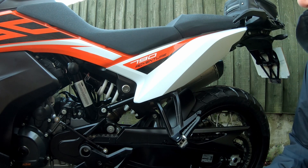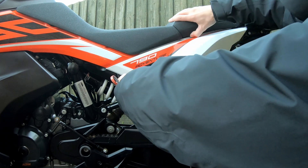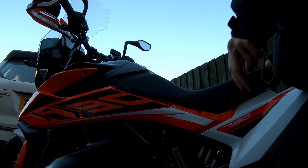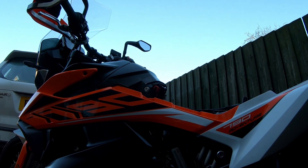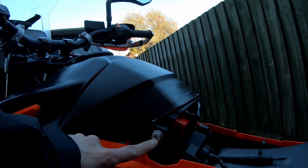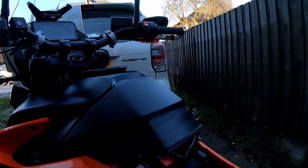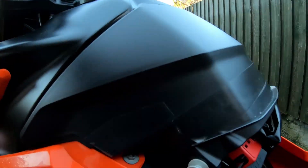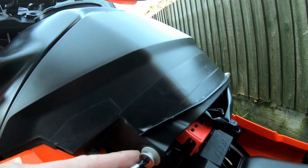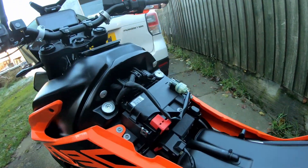As with many things, it's quite a simple job but you have to be careful. First off, I'm going to remove the rear seat and then the front seat. There are the two parts of the seat removed. The next thing is to remove this panel, which gives me access to the battery. As usual, it's just a T30 Torx — I even carry one with me. Most of this bike can be done with a T30 Torx. So you undo that, and don't lose the round clip that holds the seat on. The cover comes off and you can get to the battery.